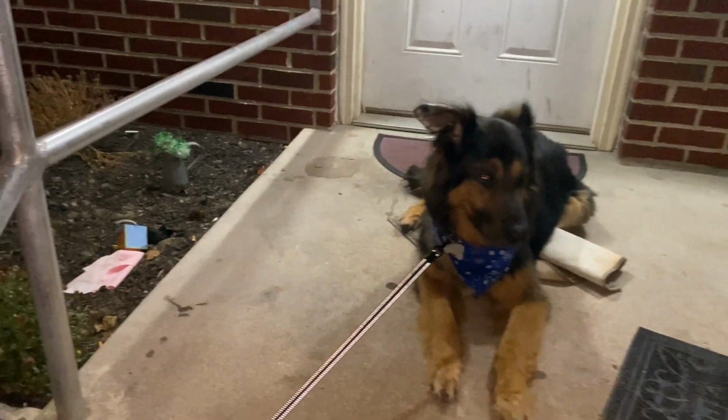I don't know whose house this is, but I think what I'm gonna do is put the trailer and the rear bumper on a tow truck and drive the NSX home bumperless and get to work on reinforcing this thing so that doesn't happen again. On the other hand, if I had attached that to the frame and I had hit a pothole that hard, I probably would have tweaked the frame because it's a monocoque chassis. The frame is the body, basically. It's aluminum. So this is a really silly idea, putting a trailer on an NSX.